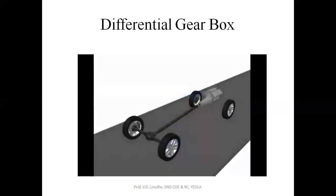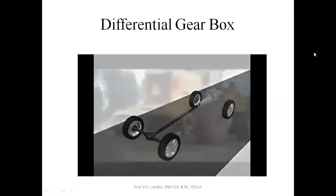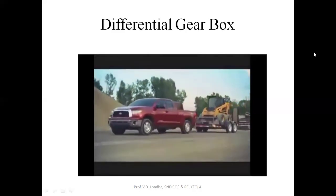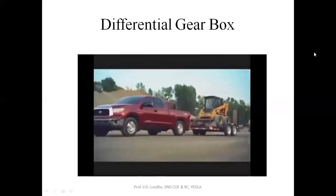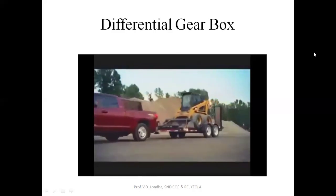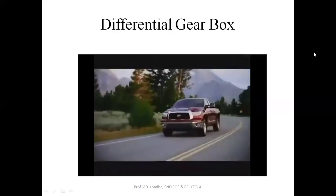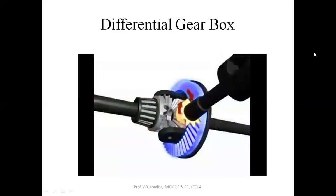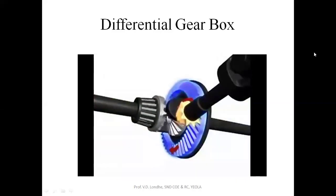All the gear ratios between the engine and drive wheels determine how much power is actually applied to the wheels. This is why some vehicles, like trucks, will have different axle ratios available. The vehicle can be optimized for either heavy hauling and towing, or normal driving and highway cruising, but not typically both. You may also hear this described as final drive ratio.